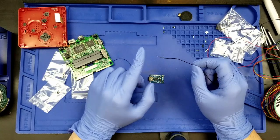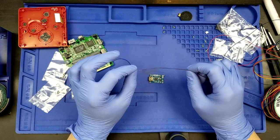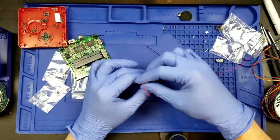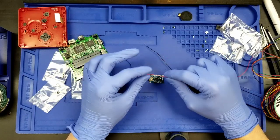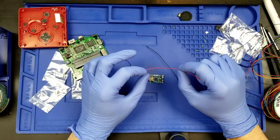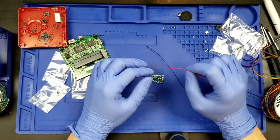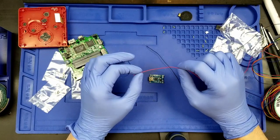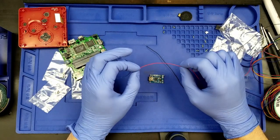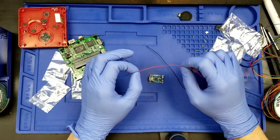We're going to be running USB-C power over these wires to charge a 1700 milliamp hour battery. Keep that in mind. We're going to be trying to charge a 1700 milliamp hour battery off of a USB-C to USB-A. We could also use the regular port, so that there are two options there for charging, but keep in mind, this is 30 gauge wire. I may be back with thicker wire with the 28 to be a little bit safer on the heat transfer.